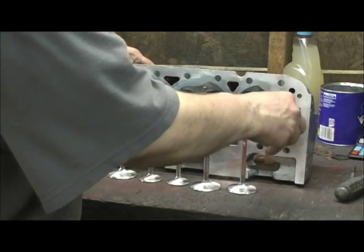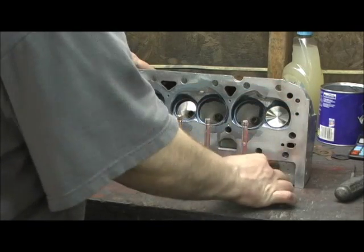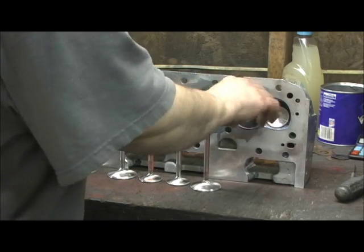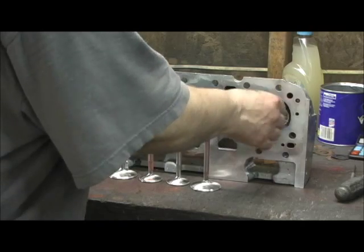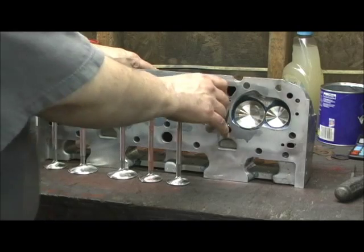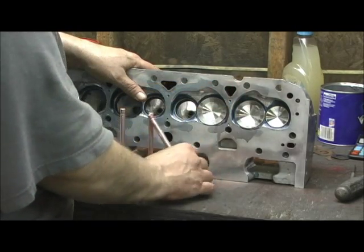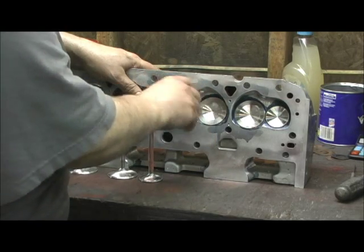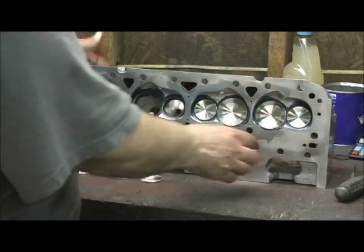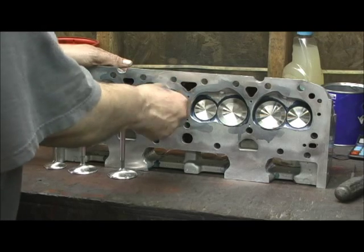When you're putting your valves in, you do it like a screw — ease it in back and forth and level it. That way you're letting that mixture get in there good. On startup it will make a little bit of smoke for a few seconds, but so what — so it puffs a little when it first starts up. That's all the lubricants burning off. You're establishing your wear pattern, it's lubricated, you don't have to worry about anything going wrong. What's a little bit of smoke for a few seconds?